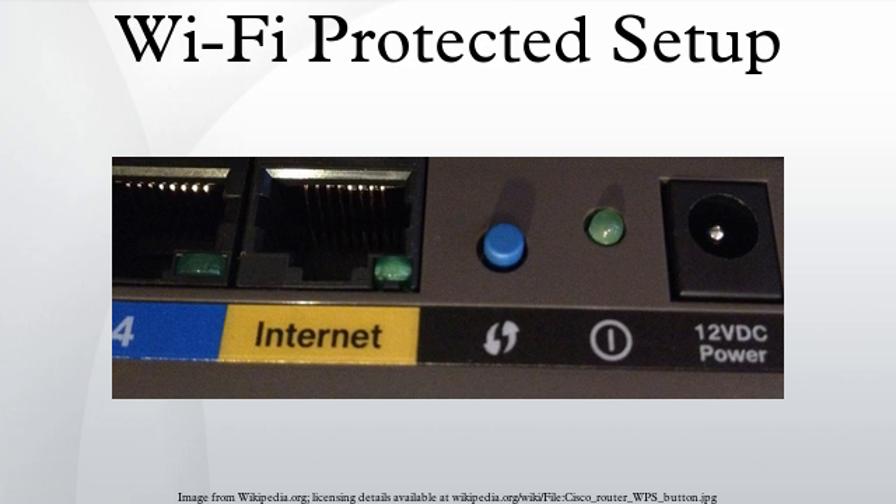Regarding flexibility with respect to band or radio selection, when the push button method is supported by the wireless access point and the wireless client under Windows Vista onwards, a prompt appears to press the Wi-Fi Protected Setup button, allowing flexibility and ease of connection with respect to band or radio selection. A number of dual-band wireless routers only have optimization options for the 5GHz band, and some non-PC devices with dual-band connectivity do not allow the user to select the 2.4GHz or 5GHz band when using Wi-Fi Protected Setup, unless the access point has separate WPS buttons for each band or radio.